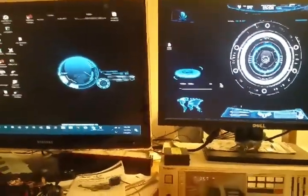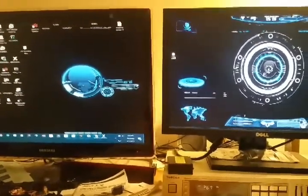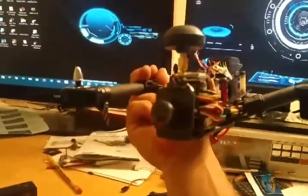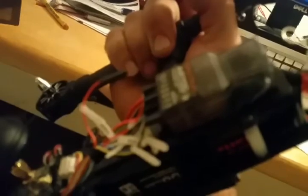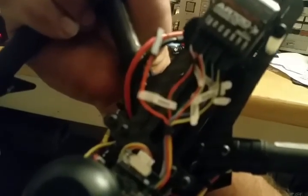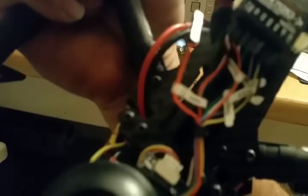What we're going to do right here is show you a quick little setup for the Crossfire. I don't have the cover on it obviously. So far it seems like a pretty decent quad — I haven't flown it yet, it has not done its maiden. It's got some bright red LEDs in the back, it comes with a battery, a flight controller, everything's installed. All you need to do is add your own receiver. I have an AR7010, which is a DSMX seven-channel receiver, and it has its little satellite underneath here so I get the maximum amount of reception.